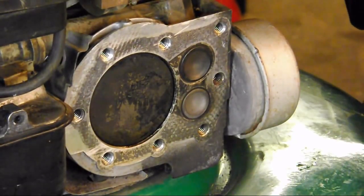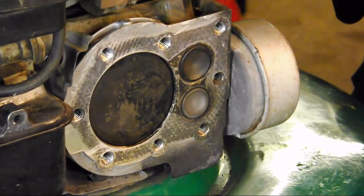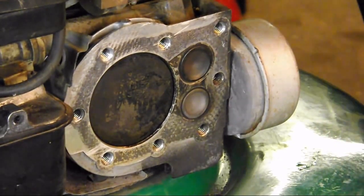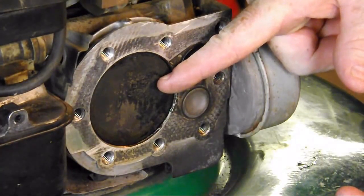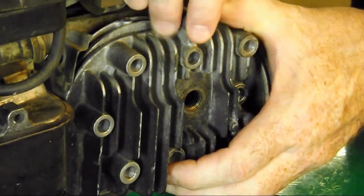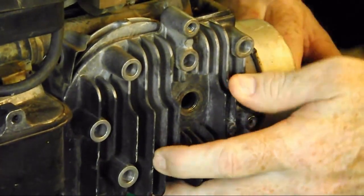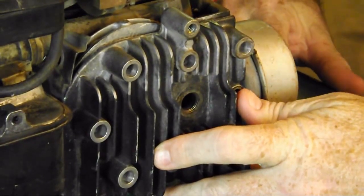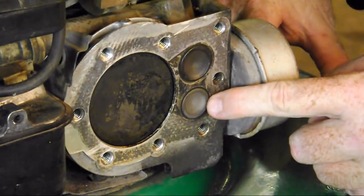Let's put this new knowledge to practical use. Say you found a rototiller or a riding lawn mower on Craigslist and wanted to see how much life is still in the engine. We could use a very simple advanced diagnostic tool. Pretend the head gasket and head are bolted to the engine. We're at top dead center of a compression stroke — both valves are closed tightly. Remove the spark plug and put compressed air into that port. Then come down to the engine and listen next to the muffler.